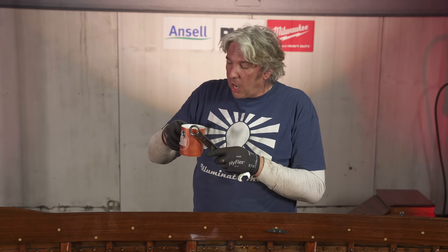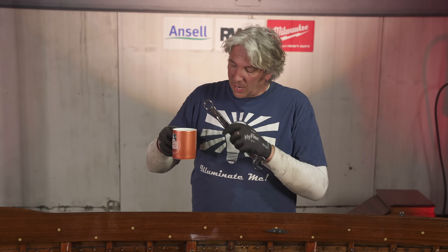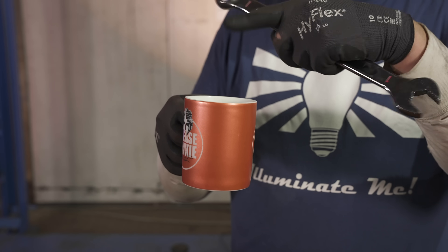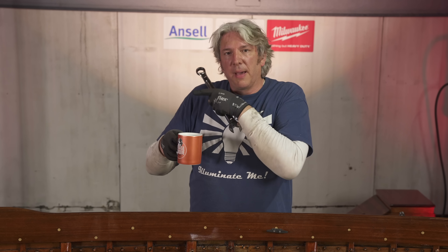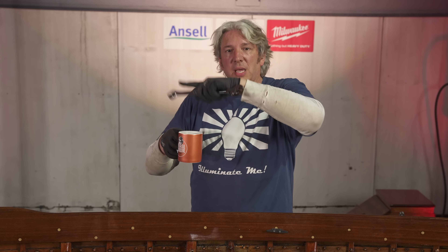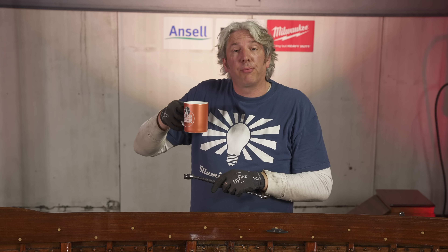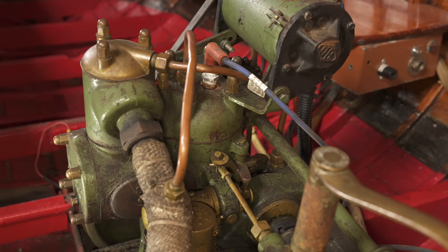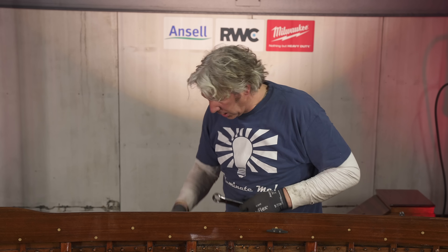At the same time, just after that, there's a port on the other side — the transfer port — and that's then revealed. That allows the compressed fuel-air mixture in the crankcase to blow up into the top of the cylinder. There's a special shape like a little ski ramp on the top of the piston that helps swirl that fuel-air mixture into the top of the cylinder. Then as the piston starts going back up again it compresses that gas. When it reaches top dead centre, the spark plug, which is in the middle of the head, fires, causing an explosion. That explosion drives the piston down, giving you your power stroke. And then the whole process starts again.